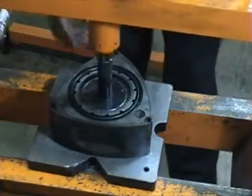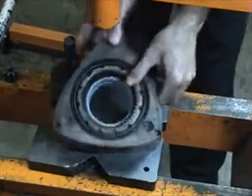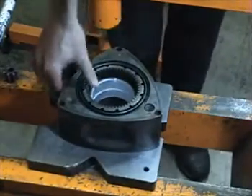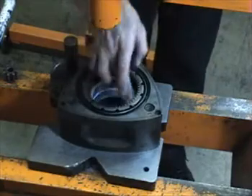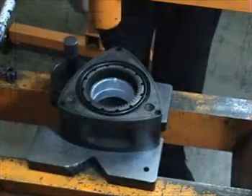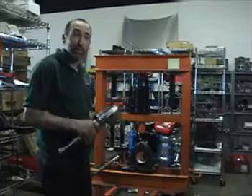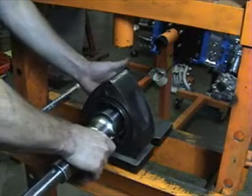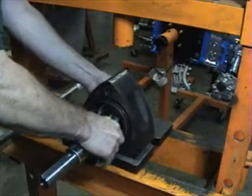Do not over-press the bearing. Once you're done, you're going to want to blow out the rotor to take care of any remaining bits. Occasionally some of the outside shell might leave a few flakes — make sure you blow those off. Then double-check your clearance with your eccentric shaft and you're ready to go. A great way at home to check if the bearing went in true and round is simply to use an eccentric shaft and gently make sure that it fits in smoothly and easily all the way through the bearing at the back side.